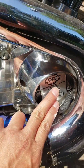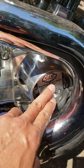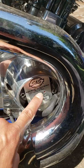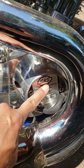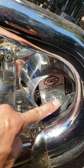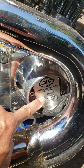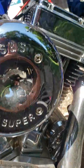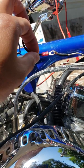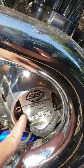Go down to your ignition module. Make sure your ignition module is unplugged and retest with the ignition module touching the bike, grounding it. By the ignition module being screwed in, the housing itself is grounding to the bike. This is the black and white cord running all the way from down here all the way up here.